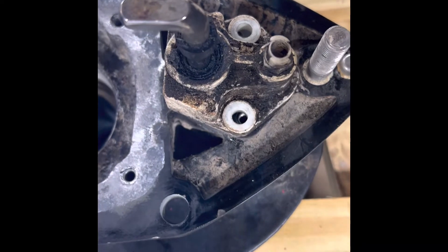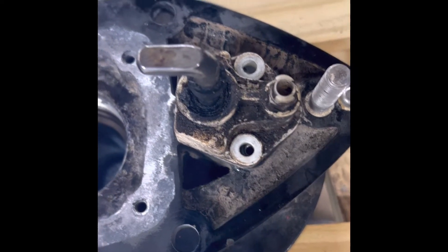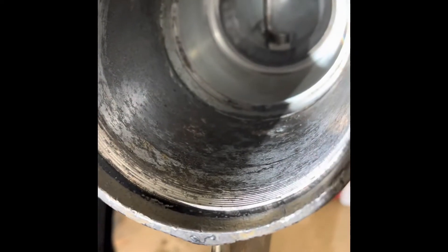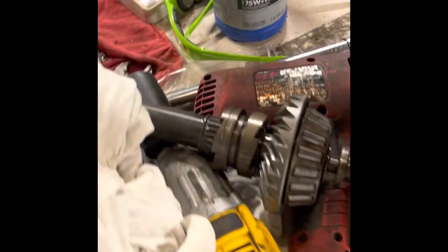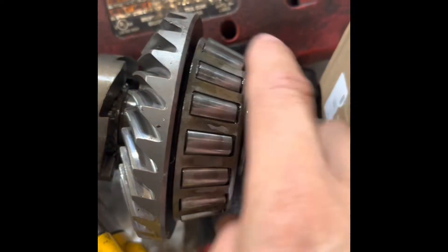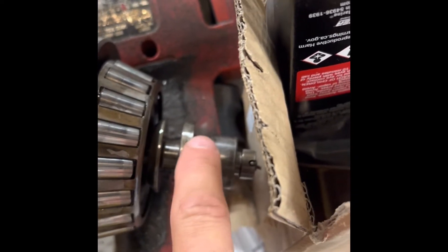Another thing I wanted to make a note of - right here is your shift shaft. It goes down to the shift crank, that little U part I was just showing you in the bottom. I found it easiest to put this back in so you can turn around and move this up here. You can keep that system stationary, because you want it faced to the left side of the drive when you're putting it back together. Up here is the part that actually has to engage with this. See this little part right here? That engages with that shift crank right there.